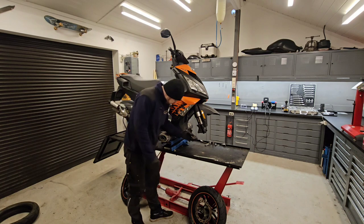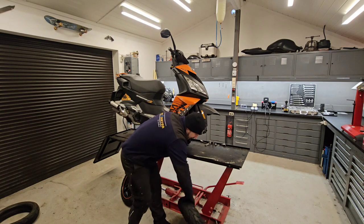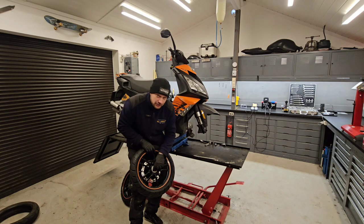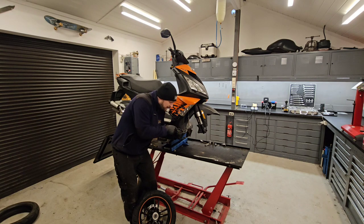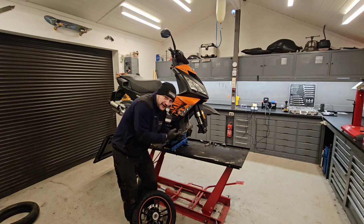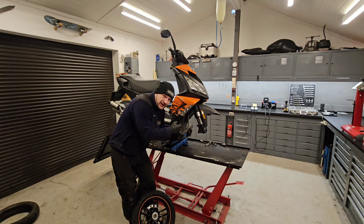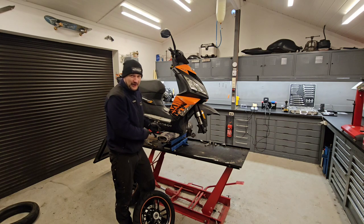Also important when you mount the front wheel, some scooters have this little, what is called a snail. This one is a snail that spins, and by spinning, the snail spins the wire that goes to the speedometer to show your speed. There is a groove on the rim. Sometimes there is one, sometimes there is two, sometimes there is four. And these two grooves, in that case there are two, have to fit precisely between these two grooves. So be careful when you put this on, because it's easy to match them perfectly, and then when you put the axle in it, you squeeze it and you can break it. So they have to be opposite of each other, so just make sure when the grooves are up and down, those ones are left and right, and vice versa. Just pay attention when you put it on. Last thing before I mount those wheels on, this is a proper way to use the yoga mat.